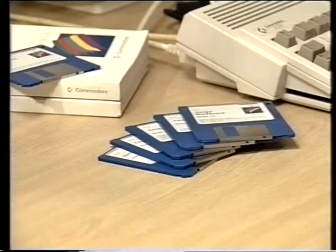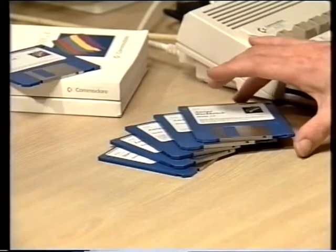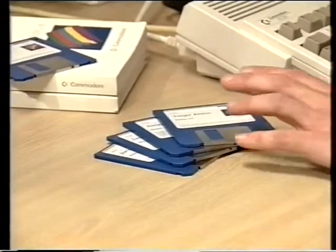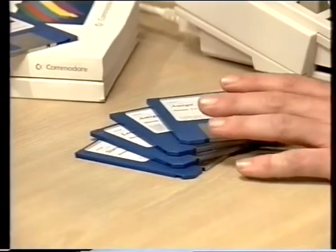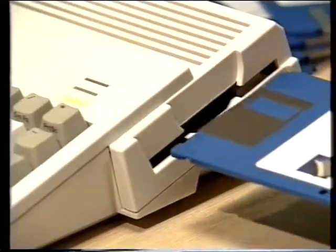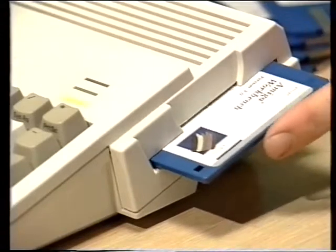Right, now that we know our Amiga 1200 and hard drive are both working properly, we brought them out of the workshop and back here into the office so that we can set up the hard disk drive using the HD install software. We'll also install the Workbench software and all the programs that we want to store on our new hard drive. You'll now need your Workbench floppy disk, so get that out from wherever you keep it and boot up your Amiga from it. If you've got the other 4 Amiga system disks handy, that would be useful too, because shortly we'll want to install the whole set onto the hard drive. With any luck at all, this should be the last time you'll need your Workbench disk.